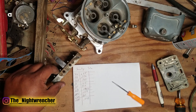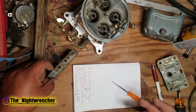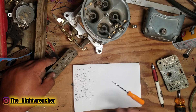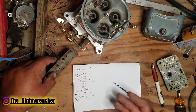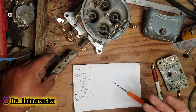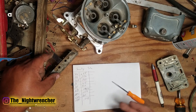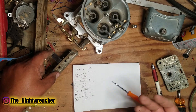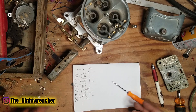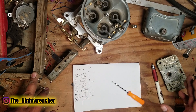The secondary side metering block came out of an 800 double pumper, and that would explain why it's got orifices that are so big. If I were to just go ahead and install it as-is, it's just going to be dumping fuel as soon as I enter the secondaries. So I'm going to have to make the adjustments before I actually run this on the truck, because I already know what's going to happen judging by these baseline readings. And that's essentially the whole point of doing a baseline reading — you want to eliminate problems, or at least deter problems before they actually become problems. If you can identify a carburetor problem before it's actually on the engine and running, you're going to be a lot happier and might save yourself from a hydro-lock situation, spark plug fouling, or killing a couple of O2 sensors.